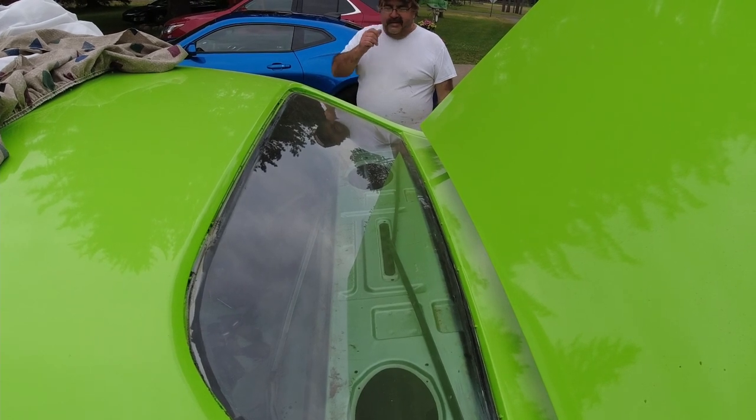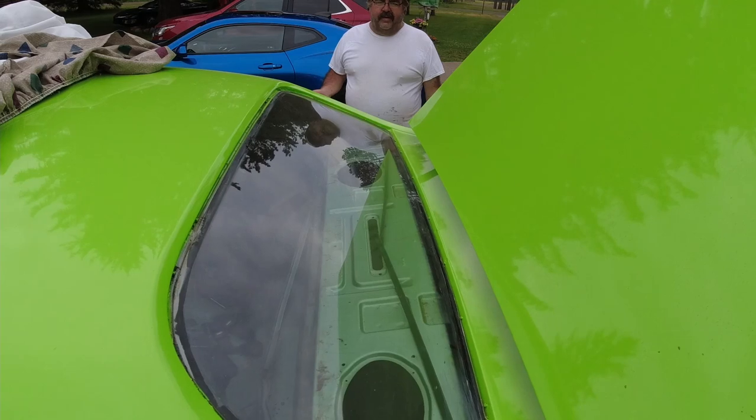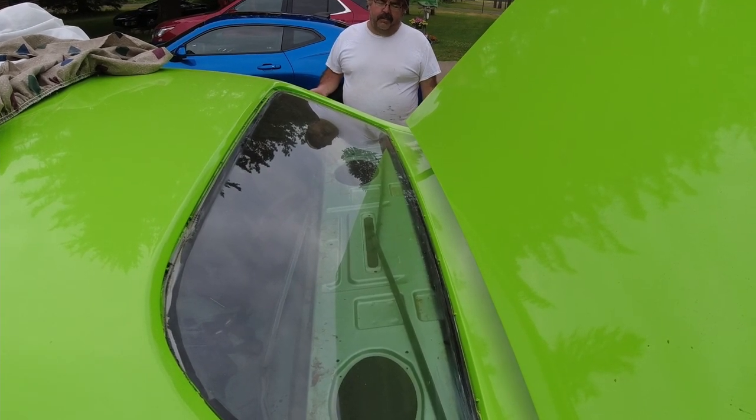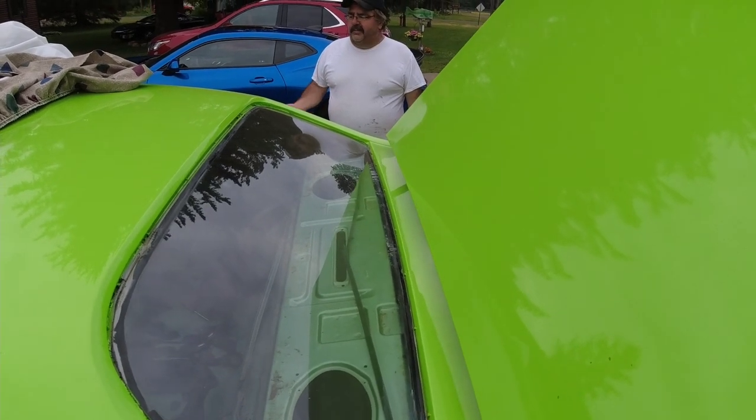I mean, the tranny, he said it worked. He said it was a little slow until he got to the end of the driveway. Then it would take off. Well, pulled apart the transmission, found out he actually had the pump upside down backwards in there. So that was what was wrong with the tranny, so we redid that.